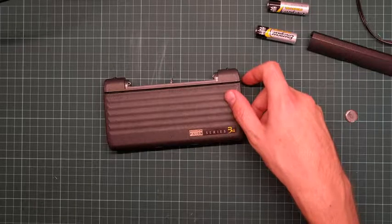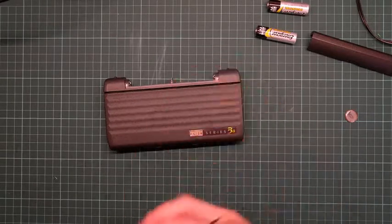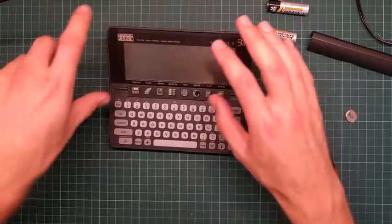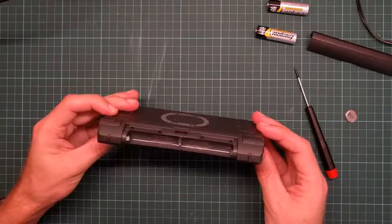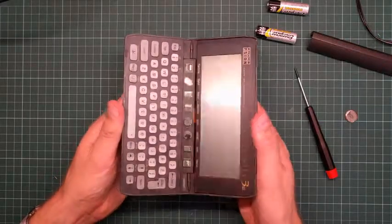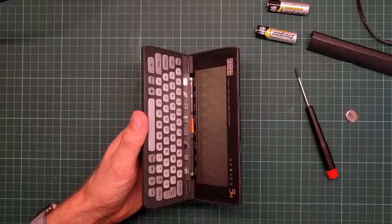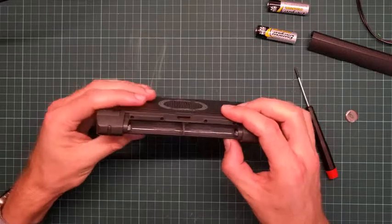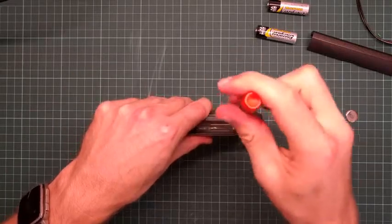Let's start removing some of the obvious screws and seeing what happens. One option is to remove the front panel of the screen and take the LCD off, and the other is to replace the entire lid assembly. It would be easier, given these things' notoriously interesting hinges, to remove the screen. However, that ribbon cable here - I don't know whether it's got a plug on the screen end. So if I were to get the screen out and realise I can't unplug it, that won't help. I'm going to do some general purpose disassembly first.